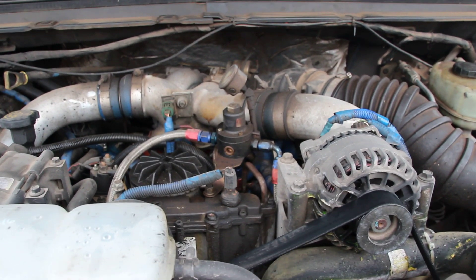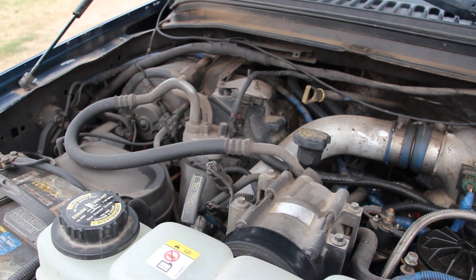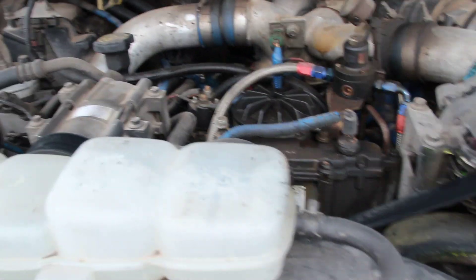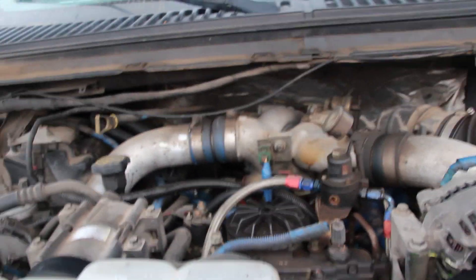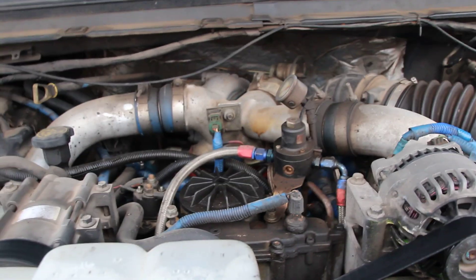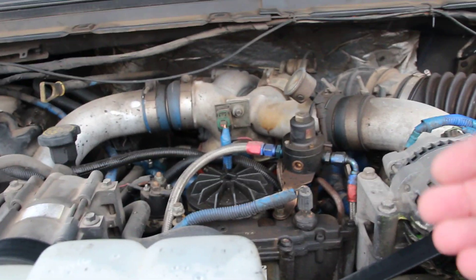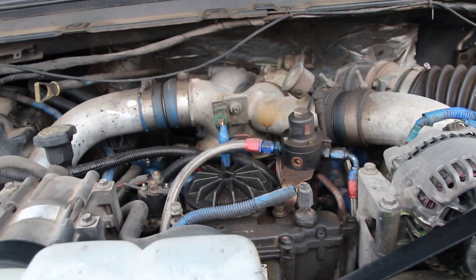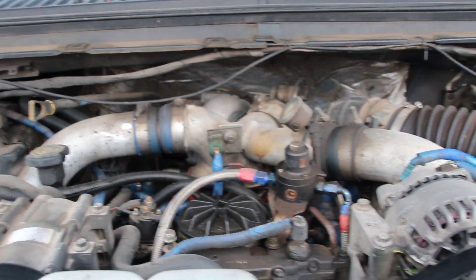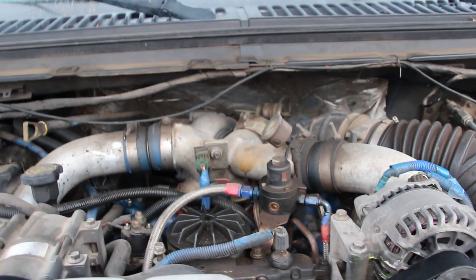The fuel pump is on the rail of the vehicle underneath. On the suction side of the pump, air can be infiltrated because the fittings they used are these quick couplers that Ford uses everywhere — you can see one right there. They use them all over the place, and they're fine under pressure. They are not fine under negative pressure, under vacuum — they allow air infiltration. Part of the problem is that the two injectors at the back of the passenger side fire sequentially and they're the furthest away from the feed point. Any air that gets infiltrated and makes it into that rail gets shoved down to the end under pressure and has to run through that number 8 injector to get out of the rail. You end up with a mixture of fuel and air — or just air — out of the number 8 injector. You get what's called cackle.